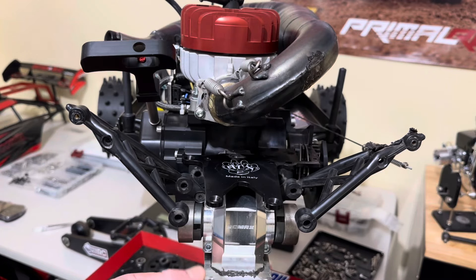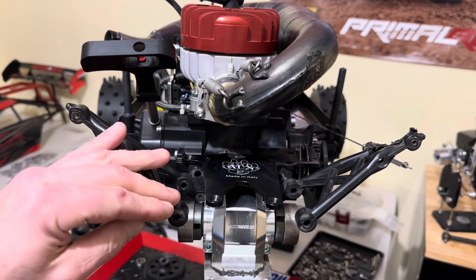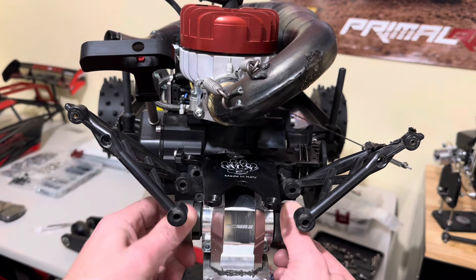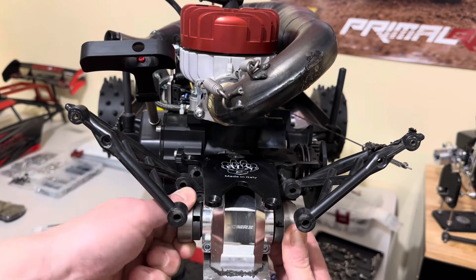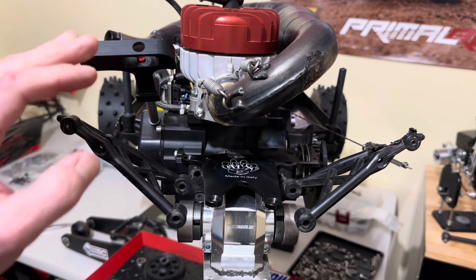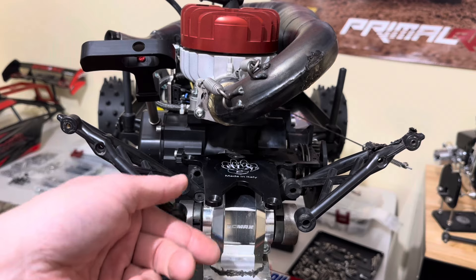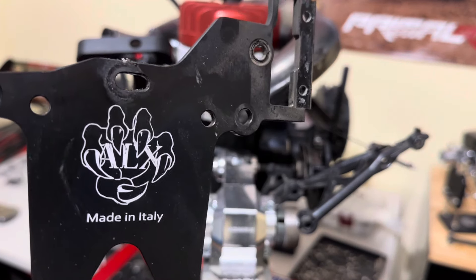What's going on YouTube? Welcome back to Eastside RC. As you guys can see, I got the ALX's rear end filleted and we're going to be taking the transmission out to find out what the diff looks like inside, because it turns pretty easy for a 1 million weight. There is some resistance still, but 1 million weight should not move that easy. When you build your own cars and create your own vehicles, everything just comes apart so nice and easy — made in Italy, son.